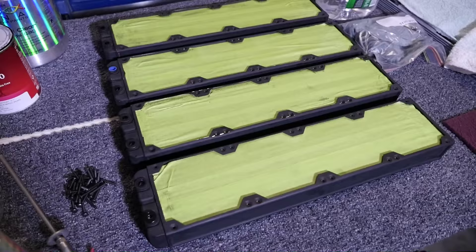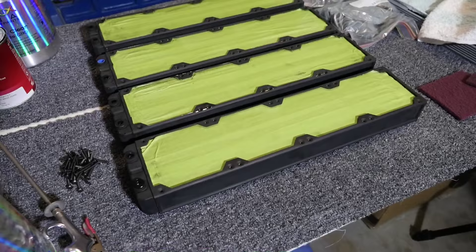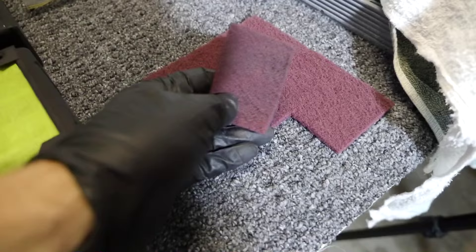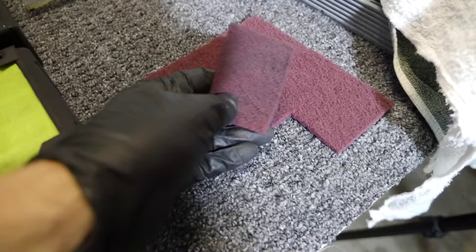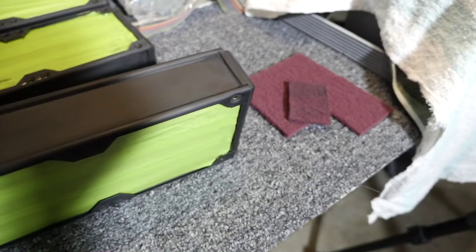There's a massive amount of tape on the roll — it lasts forever, you can probably get one roll and do this ten times. Now that all the masking is done I've moved on to surface preparation. For this particular paint job I ended up using Scotch-Brite instead of sandpaper. These paint jobs are just so soft and thin — all we're really doing is roughing up the surface a little to help the paint take and also removing any imperfections from the factory. Scotch-Brite will work very nicely for this — make sure you get a coarse Scotch-Brite.